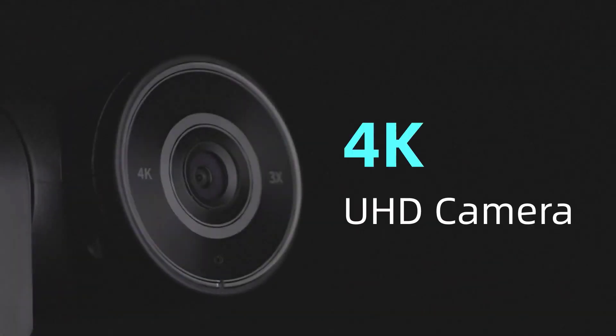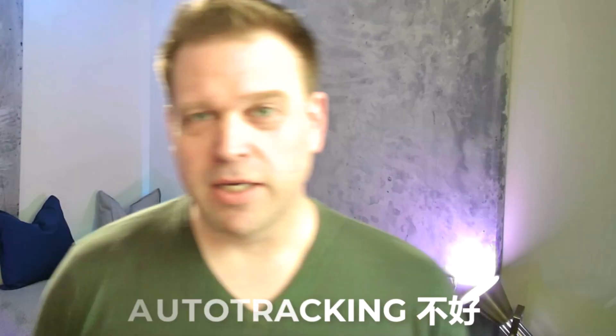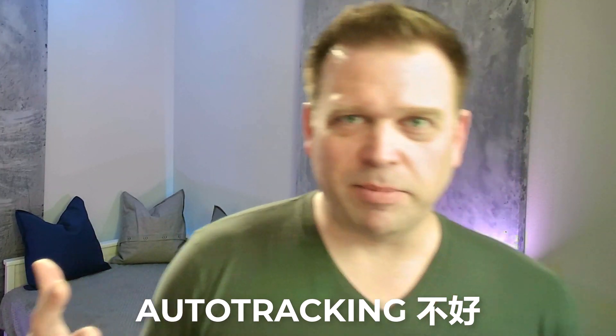Is it any good? The default image was very green — the auto white balance was setting about 300 Kelvins lower than it should, giving that military green look. Build quality is okay — the plastics aren't great but not terrible, and it's native USB-C. The main issue is the jagged movement during AI tracking, which I wouldn't use. If you just want to park the camera in one position and move to another using the remote — or program preset spots in OBS — I could see this camera being useful.